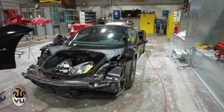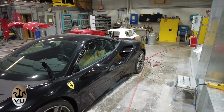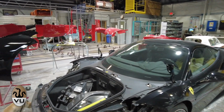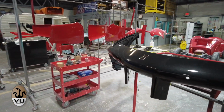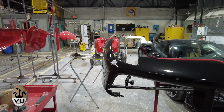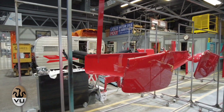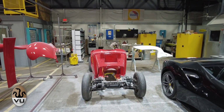So anyway, we've repainted the front of this and gone quite a ways back and re-cleared it, and we're going to smooth it or cut the paint, and it's just about done. I'll have to let it set for about a month and then do a final cut and polish on it after the paint has had a chance to shrink back just a little bit. The field of parts here, other than that Ferrari valance, is all MGTD, which goes to this car, which is now painted.